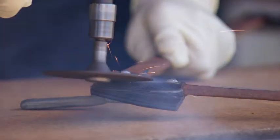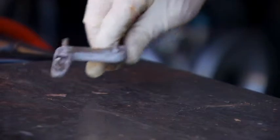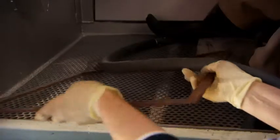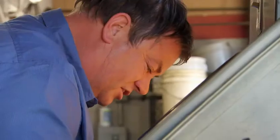To refurbish the frames, Ada cuts off the locating pins to ready them for stripping. Now it's my turn to help out. We're going to bead blast this. The fine glass beads are tough enough on rust but will leave the metal below unpitted, provided my technique is good enough. There's something quite therapeutic about doing this — I could do this as a job.